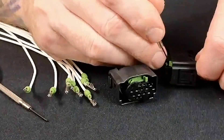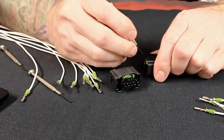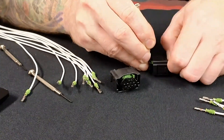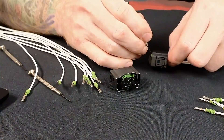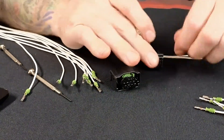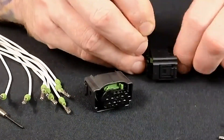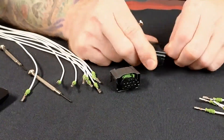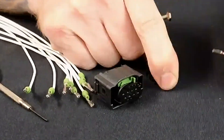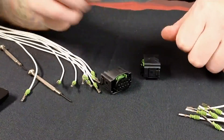If the spring catch has a little tension because it's being pushed back from the seal, you may feel a bit more pressure when pushing down. On this one you can push them forward first — that actually removes any tension. Then press down. Sometimes the catch pops up and catches itself as it's going because these are tight tolerances — these are OEM connectors. You can feel the catch go down and it pops right out. Either way, you can push it down and ride it with the screwdriver as you're pulling it out, or just push, get it to come back a little bit, then remove.